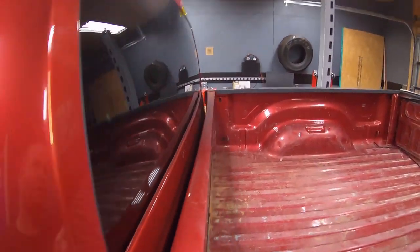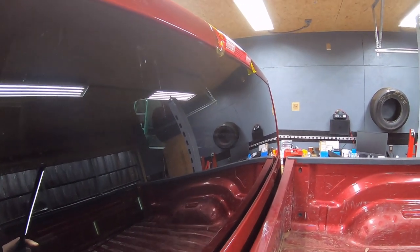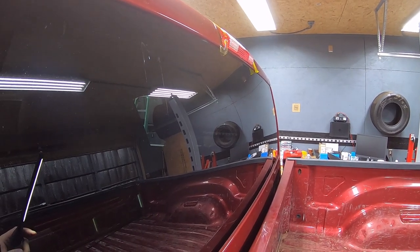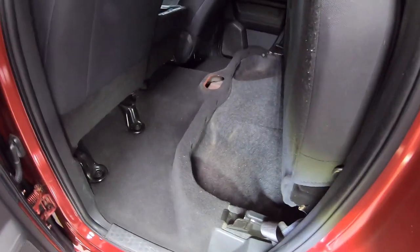So that definitively tells us the water was coming in through either that satellite receiver, that third eye brake light, or perhaps both. These third eye brake lights on the 1500s and even some of the 2500s have a tendency to leak on the older ones. We went ahead and ordered a new light assembly and a new satellite receiver antenna so we'd get new gaskets with those assemblies.